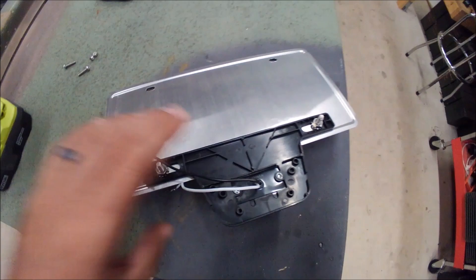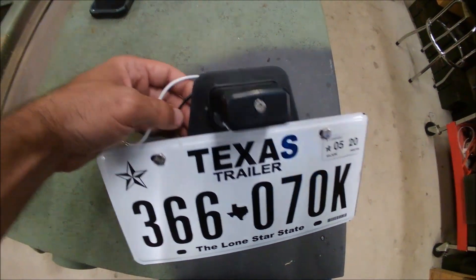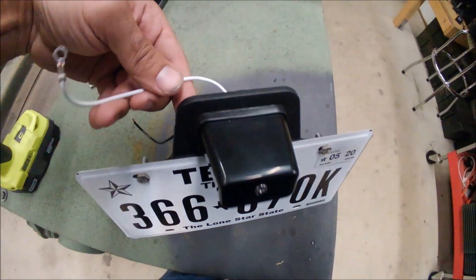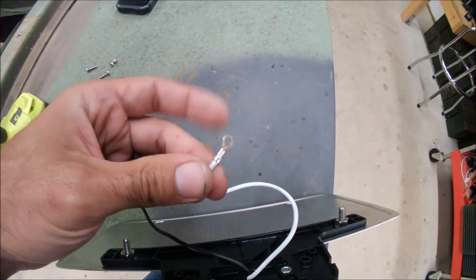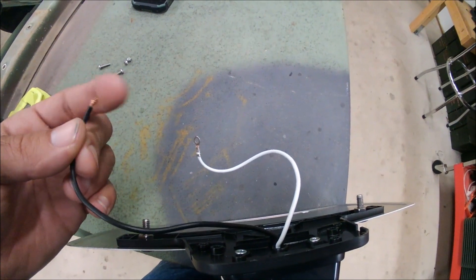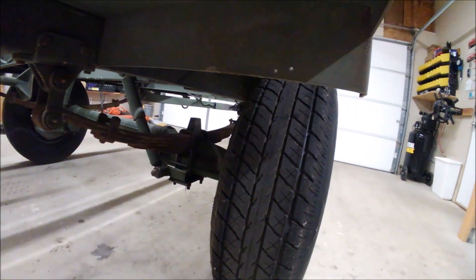Last part of this is putting on the license plate bracket. I don't have a part number for it, but it's got LED lights — it's a plastic bracket, you just screw two in. It's made so when you mount it you can also ground it at the same time. This is just going to run off your trailer's running lights. I'm going to mount it on the right-hand side up in here — you can see where I started marking some pilot holes to drill. The wire I'm going to tap into is wire number 21, your running lights.